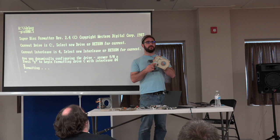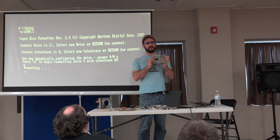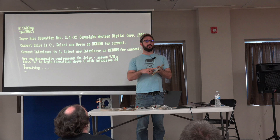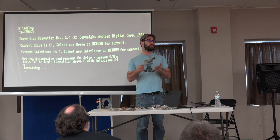It hadn't fallen and gotten into the disc or screwed it up or anything, but David said, oh yeah, I imaged this disc, I don't need it anymore. Well, I think he got the same thing over and over again because the head wasn't actually moving. I think you could actually fix that in this. You could take a new piece, get a little strip of something and drill a little hole in it and tension it and re-low-level format the drive.